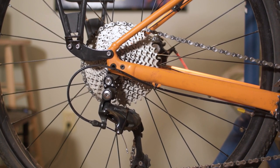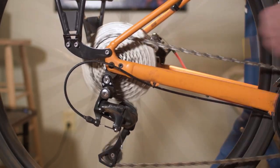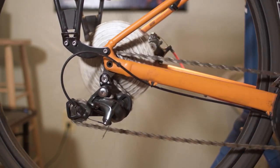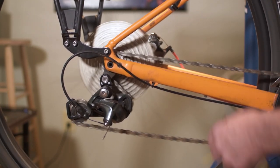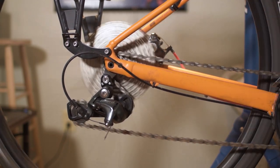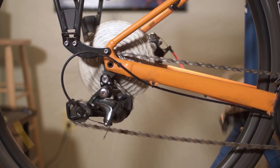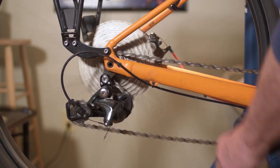Let's go through it quickly — small chainring moving through the cassette. There's still lots of room on the derailleur at the small-small end. I'm getting a little bit of chain rub on my front derailleur, so I'll do a little bit of adjustment there. But I would never cross-chain intentionally — if I do, it's just by accident, which does happen. So I like to have the clearance; I don't want it to be too tight, but I get out of it pretty quickly.